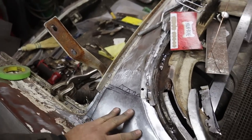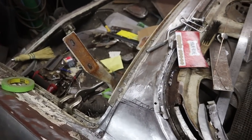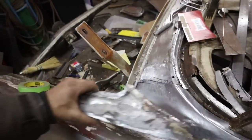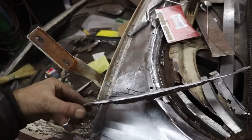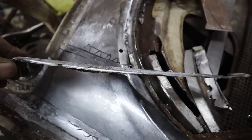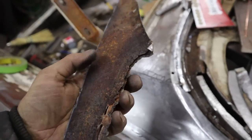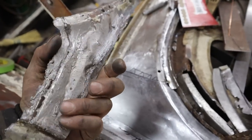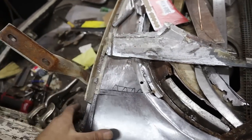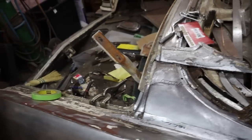Oh yeah, the joint. And again, if we're within 3/8 of an inch of where it's supposed to be, it's better than new. So let me see yours. Yeah, that's it, the old one up there, the old lead sled. We're eliminating this little stepped overlap here. I don't see any advantage. That's just a production consideration, so we're just going to weld all that in there. We only have to produce one.